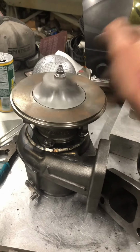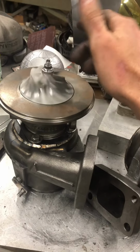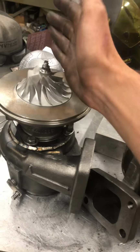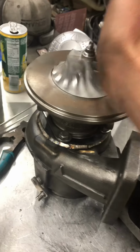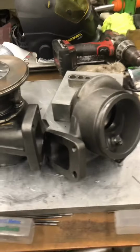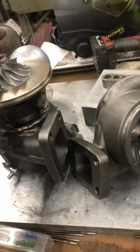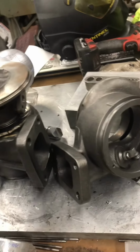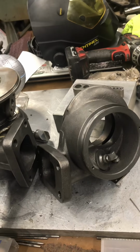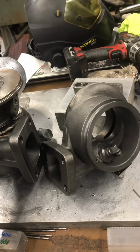Look at, like, the smallest I'd run is obviously the 55, which is, if you want to call it smaller based on flow, the 12 valve 8-blade wheel actually has a lower flow capacity but a little bit higher pressure ratio capability than the late model 7-blade 55 millimeter wheel. The 55 millimeter wheel has a higher flow capacity but doesn't like to quite run the pressure ratios that the 8-blade does. From there, you got your HX40 wheels, 58 all the way up to the 60 mil.